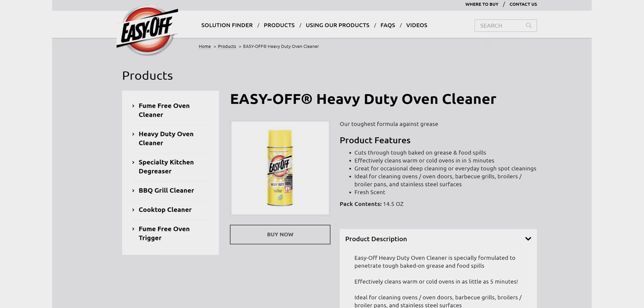It did have kind of a horrible spray pattern even compared to the primer from the local paint shop. But a few light coats with a heavy overlap, followed by a wet coat, and of course some clear coat to improve durability a little bit — and we've got what I would consider a three-foot paint job. From outside of three feet, it looks pretty darn good.